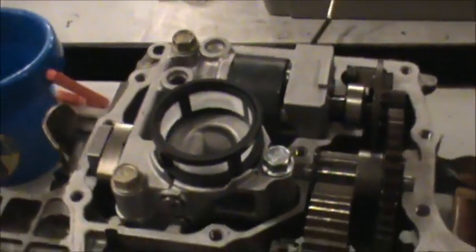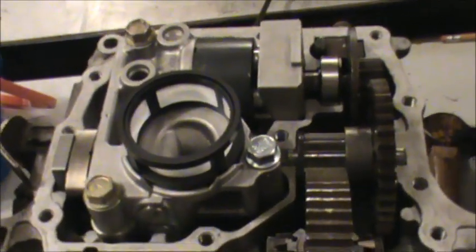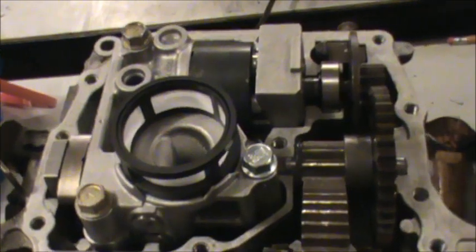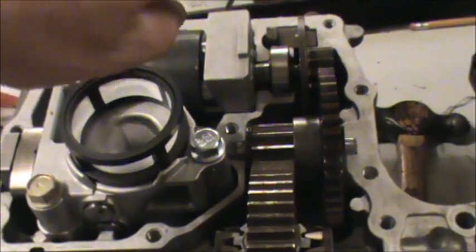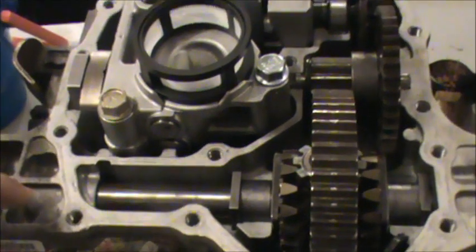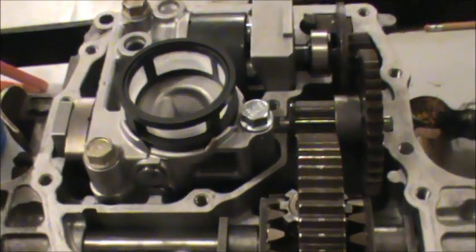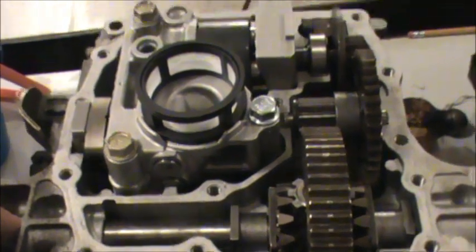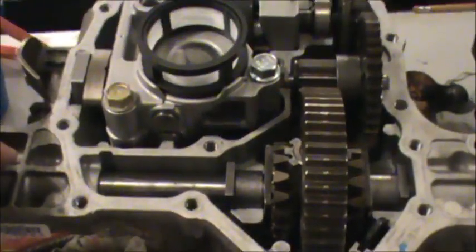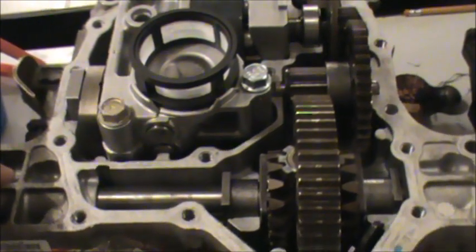If you're going to rebuild these pistons, make sure you lube them as you go. I pulled mine out and inspected them without wiping the oil off, then put them back in. I'm going to add some oil around here to make sure there's enough to at least get this thing going, then RTV this thing up, let it dry overnight, and after it's torqued we'll fill it with oil tomorrow and attach it to the tractor.